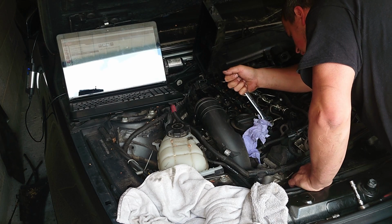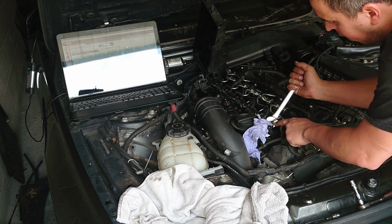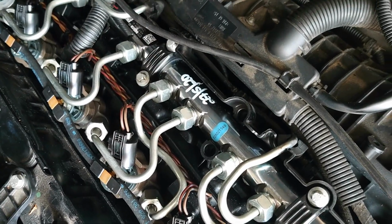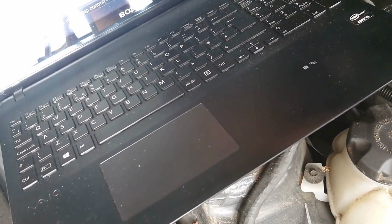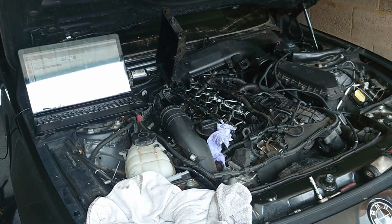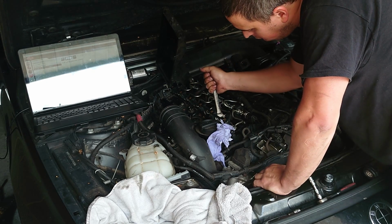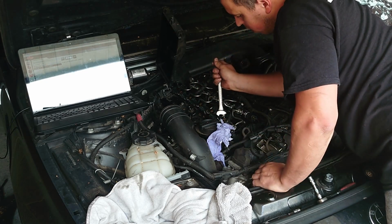This one in here. See the fuel come here? You can see the fuel already there. And you can hear the buzzing. So the pump is doing its job. Okay, so I stop again. Start again. Just do it three times. There's still lots of air in the system, but at least that one is nearly done. I will probably do one more. That's it. The diesel's already here.